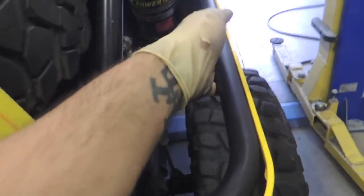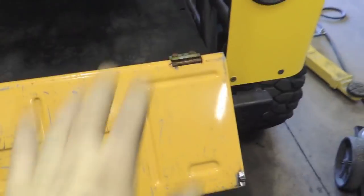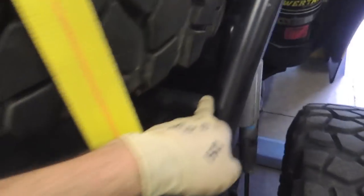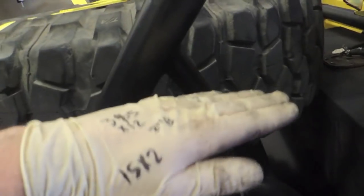When I first met him it didn't have any of these sides on it, so I bent up these tubes for him a while back and made all the mounts. It still didn't have a tailgate and the spare tire was mounted weird. What he wanted me to do was mount a tailgate and make new mounts for the spare tire — so I welded in two tubes across, used a three-way strap, welded bars in to locate it from sliding too far forward, did little tabs to locate the strap, and mounted a slide-out box down below.